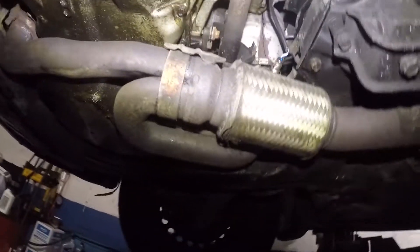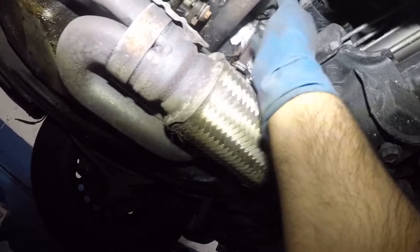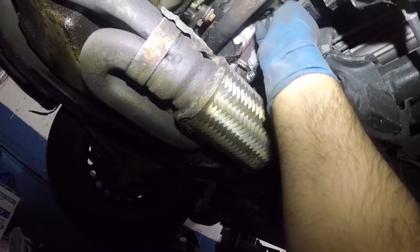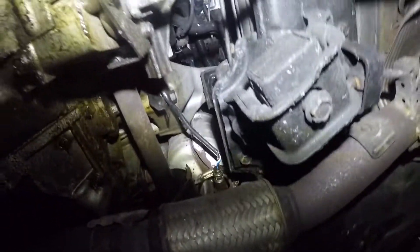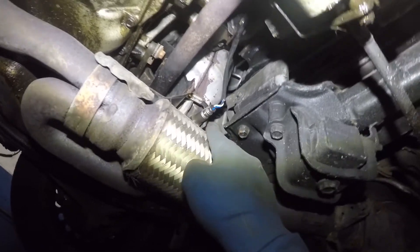There you go. The sensor harness should now be loose, but the sensor itself we still need to loosen. We'll use an oxygen sensor tool to remove it. Save the old zip ties because we're going to need to zip-tie things back together. Once we're done up top we'll remove the sensor from the top, then install the new one from down here and let everything work out. You won't need to come back down once you zip-tie the new sensor.